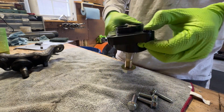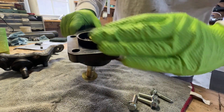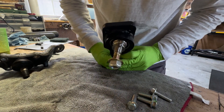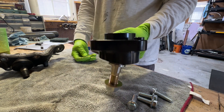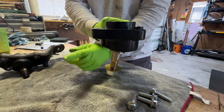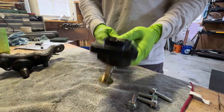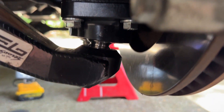What Total Chaos did is angle the bottom of the cup. The joint sits flat, but you can see inside that the actual race is angled inside the housing. So when you're sitting flat at ride height, the ball joint is already at an angle — you're already compensating for a leveling kit or lift kit. As the suspension drops and has to move forward, you won't get that bind at full droop that you'd have with the factory joint.